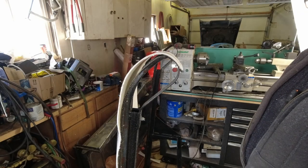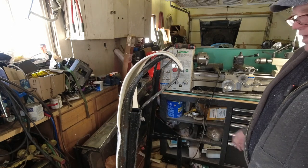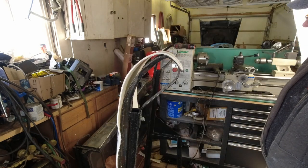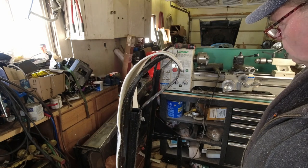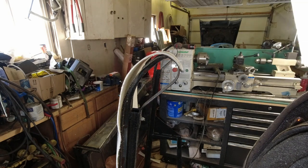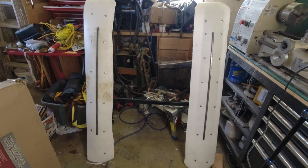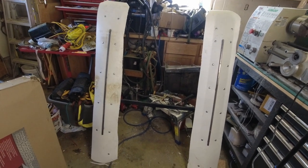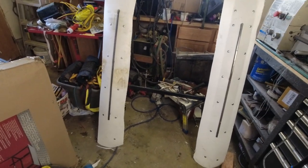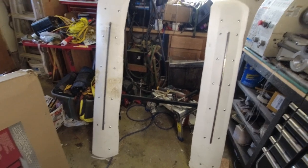That has our skis repaired. They're not completely centered — we've got two and a half inches on this side and two inches on this side, give or take. I don't really care; we're definitely going to have a little better flotation with this and it should do a good job. Now I've got to rinse and repeat on the other side. The ski skin on the left didn't turn out quite as well as the one on the right — somebody was not following a straight line when they were cutting these out — but I think they'll work just fine. We're also missing a rivet at the bottom; I ran short and had to drill a couple off, leaving me with not quite enough to finish.